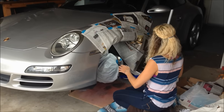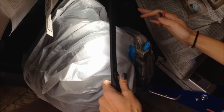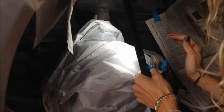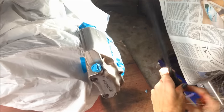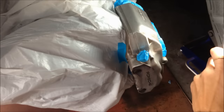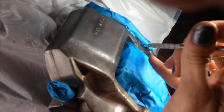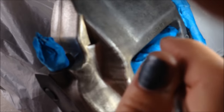Here I am at the masking off process and I wanted to show you guys how I did it with the trash bag. I just put the trash bag over the entire disc, then I punctured a little tiny hole and just let the hole ease its way over the caliper so it just naturally goes into the area that I want. I have these tools that I'm using for placing the tape way up over the areas that you do not want to see any paint on.